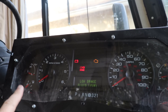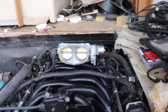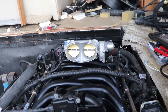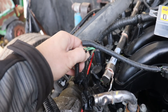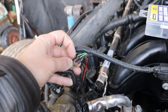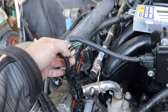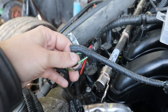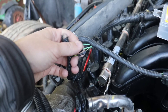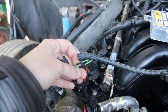I just don't understand it. I have plenty of fuel — a lot of gas in the tank. I was able to take off my fuel line and fuel was coming out when the fuel pump engaged, so I know I'm getting fuel. I did mess with the air mix ratio box, so that might be changing things. I had two green wires and one black and green wire, so I kind of guessed — it's a 50-50 — so I'm going to swap them out and see if that does anything. I'd use heat shrink wrap for a nice clean look; it keeps the moisture out, because exposed wires start rusting and become brittle and fall apart.